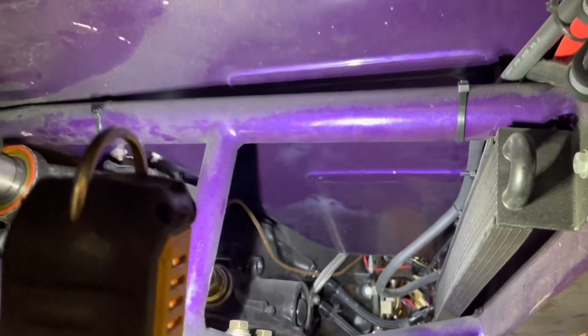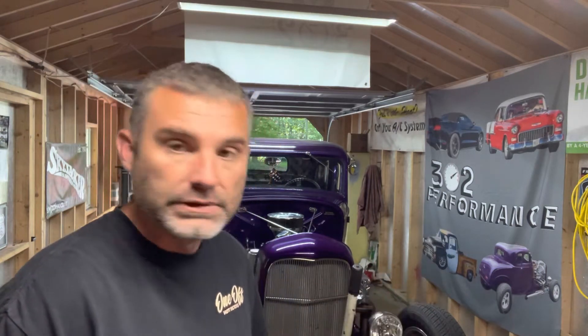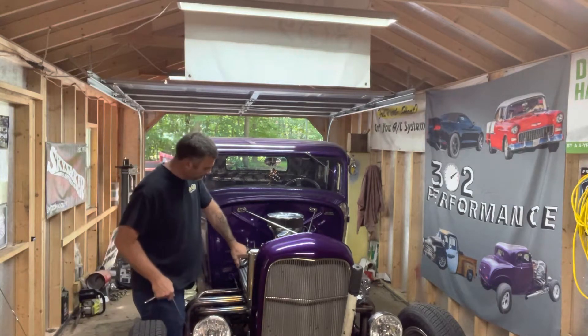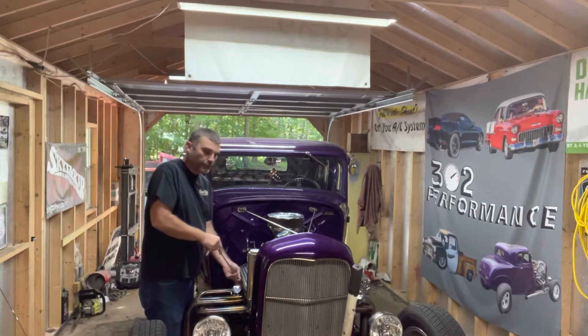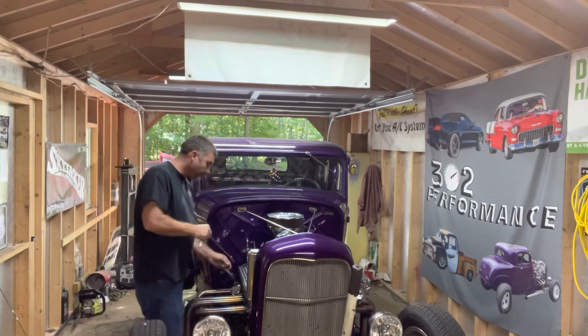So far it's not bad. The shock mount is the worst thing I really have to mess with right now. That's a 20-minute job — pop the headlight off, pop the shock off, put a nice MIG weld on that one, and I can make that one myself. The rest of the suspension is chrome moly so I'm gonna have to use a TIG. I'll get it up on the lift, I'll probably end up buying a TIG eventually and learn how to TIG, but for right now I'll probably have somebody come over, bring their TIG, and do a couple bars up there for me real quick.